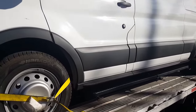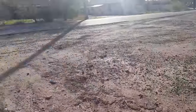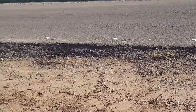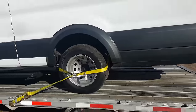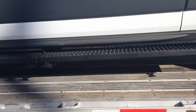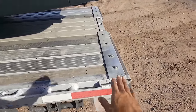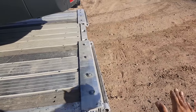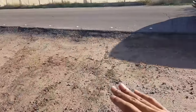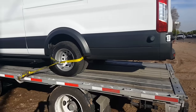Next I got the armored van. Now this van was a pain in the ass to do. As you guys can see, I'm out here on a dirt field — and I'm out here on a dirt field because I had to utilize this road right here. You see where the drop-off is at? I had to utilize that curb drop-off to get this van onto the truck. The reason why is because these steps on the side — they're so low. If you try to load it on the street, by the time it gets up here, it's going to start scratching on the ramp, and that could be a claim issue. So what you have to do is find a level area where your trailer sits lower than the road does, so you can drive the van on there smoothly and evenly without scratching and scraping.